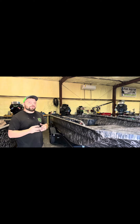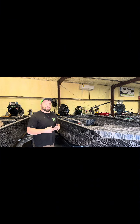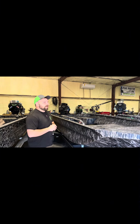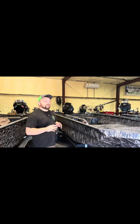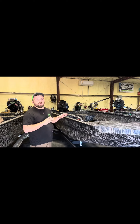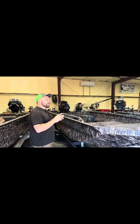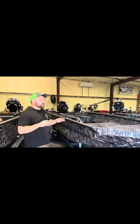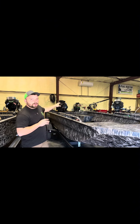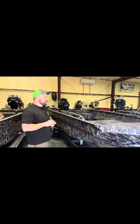The next thing is they changed the cam profile. I reached out to Mudbuddy this morning and they gave me a rundown on why they changed it and some of the things they did. So I have to go out today and make a brand new tune file for the new Mudbuddy 5000s. They said any motor produced in the past 60 days that's a 5000 would have the MLS head gaskets, but please check before you just trust that.